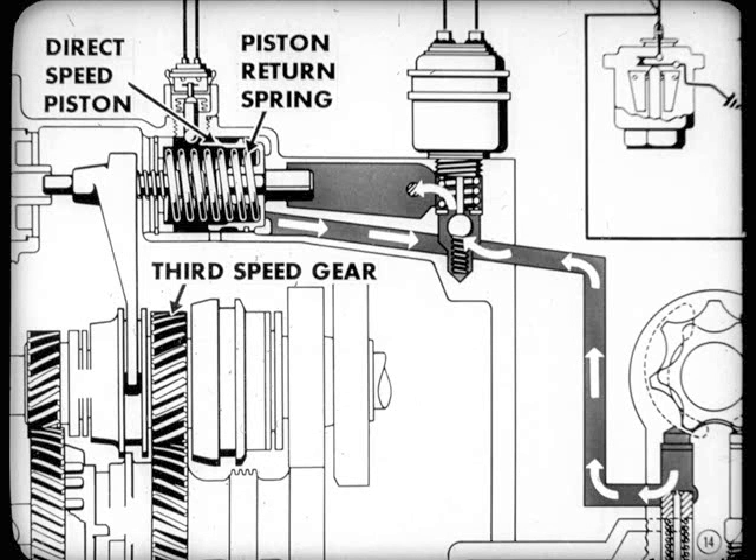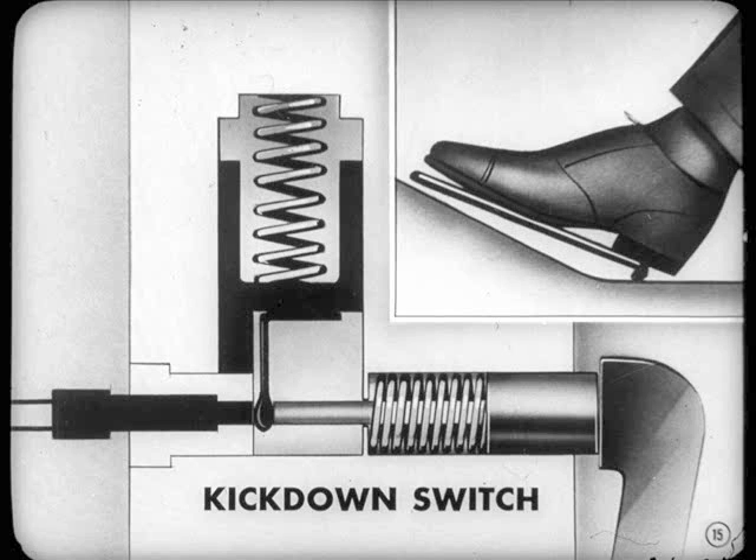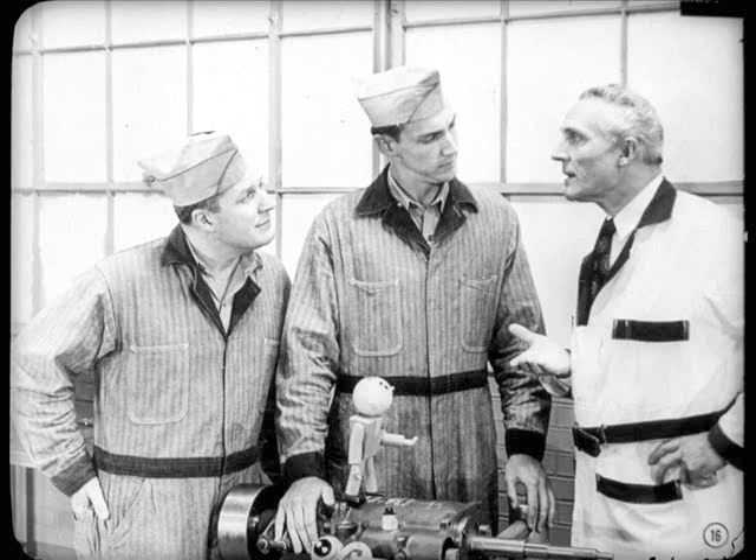So if you're in the driving range, the transmission stays in third speed. But if you were in fourth speed and wanted to shift down to third in a hurry, you'd do it through the kickdown switch by pushing the accelerator pedal all the way down. On the upshift, everything is up — the driver's foot is up off the accelerator pedal for a moment.